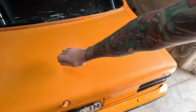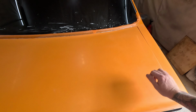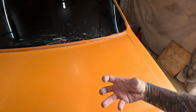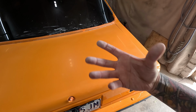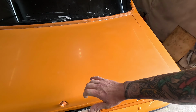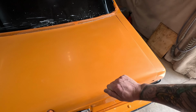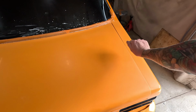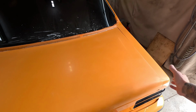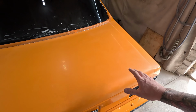Another thing that I do, you sort of do it systematically, don't just do a bit here and a bit there. You can get away with just doing wherever when you're sanding a car down for paint, because the orange peel or the gloss is your guide coat, if that makes sense. But here, because I don't have any guide coat, you really want to do it a bit more systematically like that, up, down, across, and work over each section sort of 5 to 8 times, something like that, you know, 5 to 8 passes, and that should generally do it.